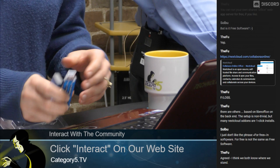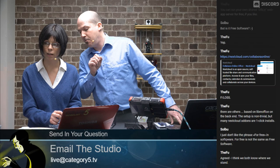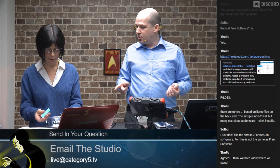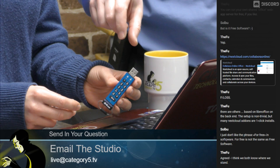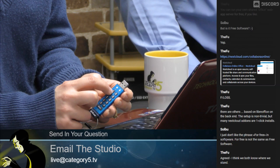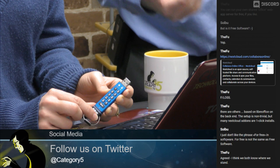The default password is 11223344. The way this works: if you plug the drive into your Chromebook or Windows 10 laptop while it's locked, it's basically like nothing is plugged in. As soon as you decrypt it by entering the password and pressing the lock button, it becomes accessible. You can see the red light flashing — that means it's encrypted. Enter the password, press lock, and it goes green — now it's unencrypted and readable by any device.